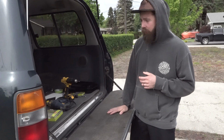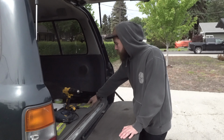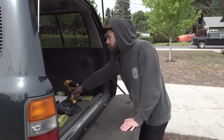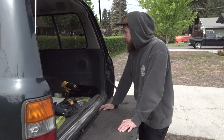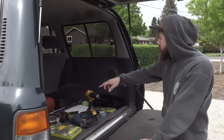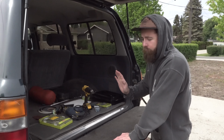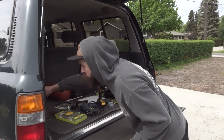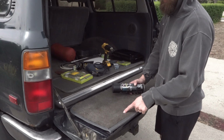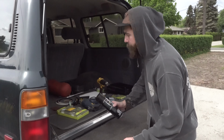So what you're gonna need to have is whatever you're using for your gate cover. You'll need to have metal saw blades, a jigsaw, like I said, a drill. We bought some self-tapping screws, and then a template. Painter's tape is helpful. I also have some weather stripping, just because I wanted to try and make sure that these are fully sealed. And then personally, for Vanessa and I, we're actually going to put bed liner onto the tailgate afterwards, just to help prevent wear and tear on the tailgate, because it's just gonna be raw metal. So we want to prevent that from happening as well.